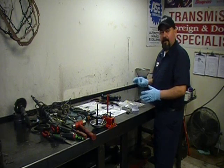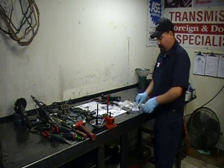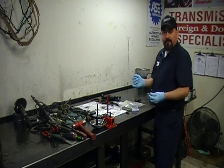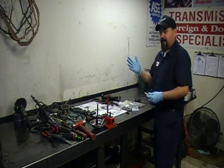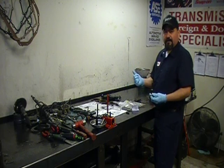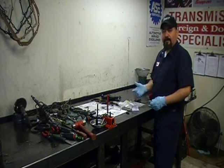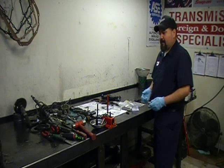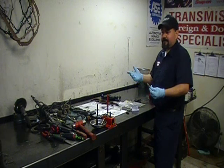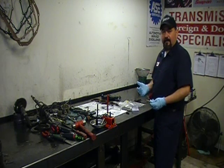This is what goes into all of our Honda units - we always try to keep them updated. This method is a little better than drilling. If you create a leak like I showed on my other video and your vehicle stays stationary for a week, the converter is going to be partially discharged. When you start the car there's nothing there - you've got to let it warm up for the converter to charge up again. But that's only if you leave it for a week or more. If it's a daily commuter, you'll never have a problem drilling the converter charge line.